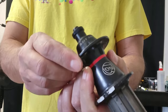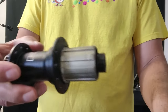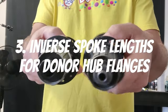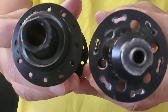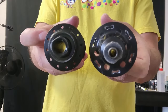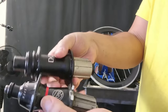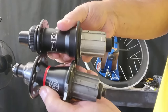We have our nipples secured and we're going to take a look at the broken hub. The flanges are ripped right off. Here's our donor hub — it's an HED OEM hub. One of the first problems we'll run into deals with spoke lengths. We're going to have to inverse the spoke lengths for the donor hub flanges, ensuring the spokes on this side aren't too long, because they're not the same hubs. Experience has taught me that disc hubs should use basically the same length spokes. Since the original hub is not a disc hub, the non-drive side has spokes two millimeters longer. I'd rather have those two millimeters on the drive side of the disc hub and have higher tension on the disc side.